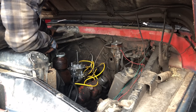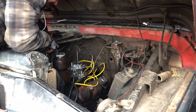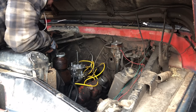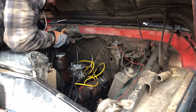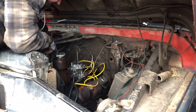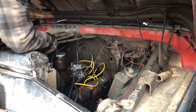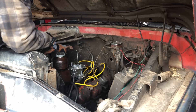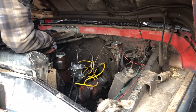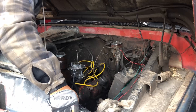I always wondered if this little carburetor I bought was maybe two sizes too small for this motor. This was a $79.95 'Kung Fuburator' straight from eBay. I think if this were maybe a 3.8-liter V6 and not a 6.6-liter V6, that little carburetor would work pretty good. There are times when I've been here working on this truck with it idling, and you just pour the brake cleaner or carb cleaner right to it — she smooths right out and runs like a bullet. Long and short of it, that tells me this thing's always been running fairly lean.